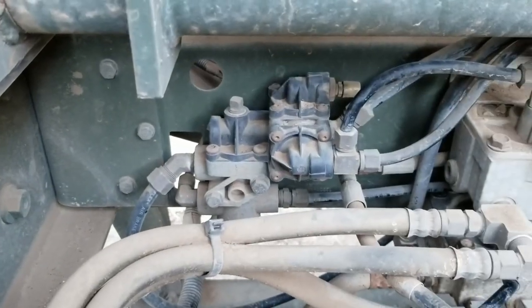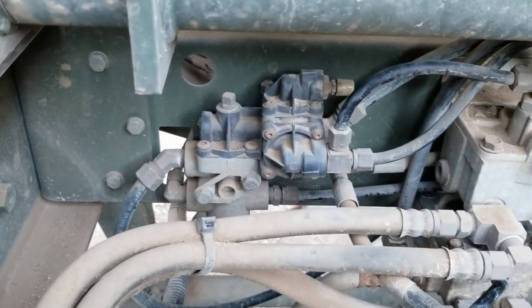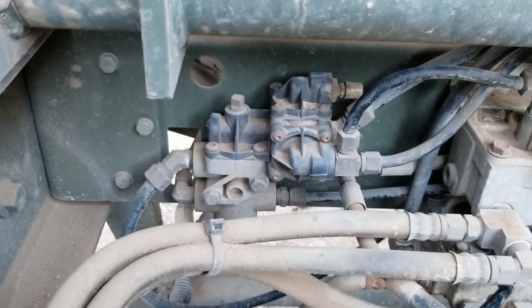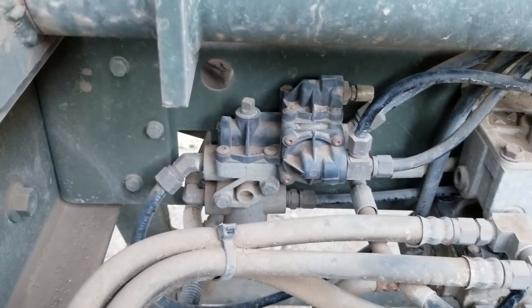And taking a quick look on Steel Soldiers, it looks like the diaphragms in these valves commonly go bad. They're cheap, like $30 from NAPA. So I'm going to go ahead and get one of those and we'll get this fixed up,